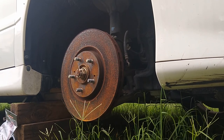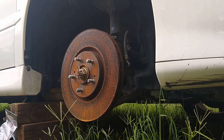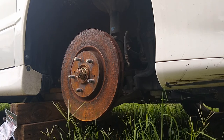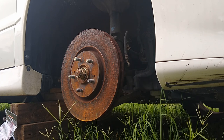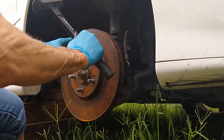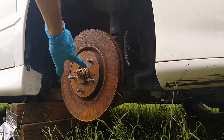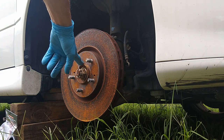In this step we're going to remove the brake rotor. We'll be replacing them along with adding steel braided lines. The rotor is seized to the hub so we're going to need to coerce it off. I'm going to try first with a plastic mallet - if that doesn't work I'll move to a metal mallet. We won't be reusing these rotors anyhow so banging on them a little bit is not going to damage anything. I'm going to try some penetrating lubricant right around where it's stuck and see if that breaks it loose. If not, we'll add some heat.